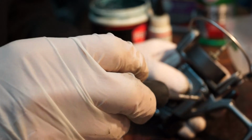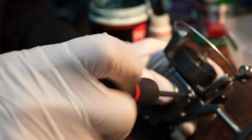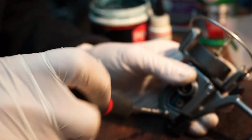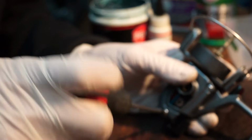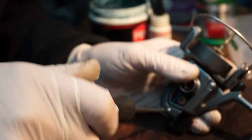Like anything else in real repair, you need to be a little bit sensitive to the touch and feel of the mechanicals. In this case this is a metal jacket, but if you have plastic-sided shields, don't over-tighten the screws. That would put undue pressure on the main drive, and it would also tend to crack it if you get real brute force with it.